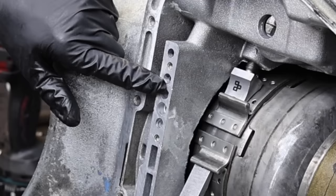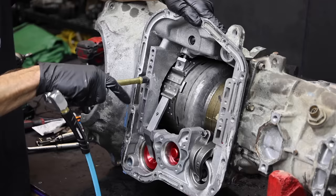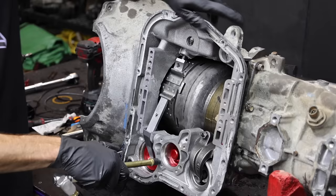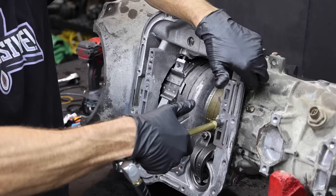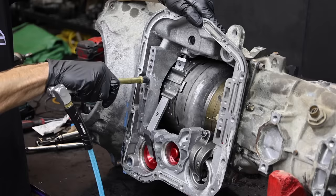What are these holes for? From bottom to top, the holes are third, forward, lock-up, and release. We only need to test the bottom two holes. We're running a pressure test — a one Mississippi count is perfect. Let's move up one hole and run the pressure test again. Let's test the second gear servo next — if you have a rip seal or something, it will just collapse immediately. Let's test the low reverse servo and then the overdrive. Let's check the check valve by covering the hole, pressurizing it, and uncovering it. The piston is holding air and the check valve is not stuck — fortunately all the air checks came out very good, so this transmission should be hydraulically sound.